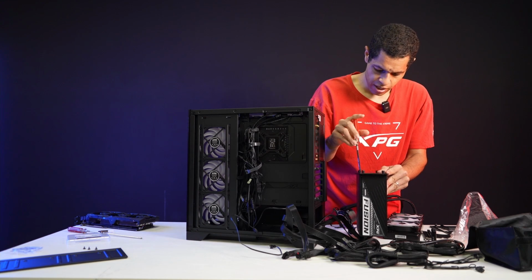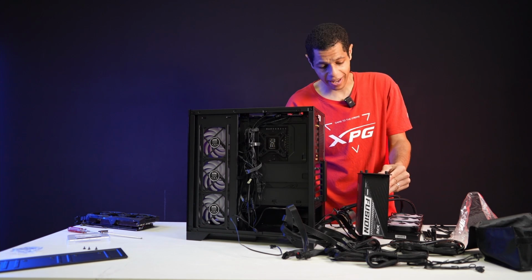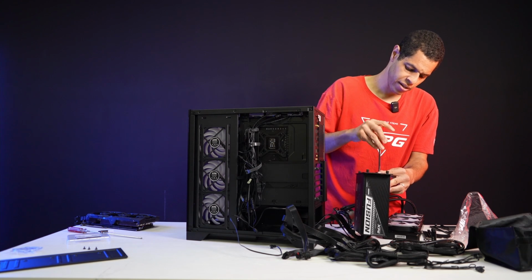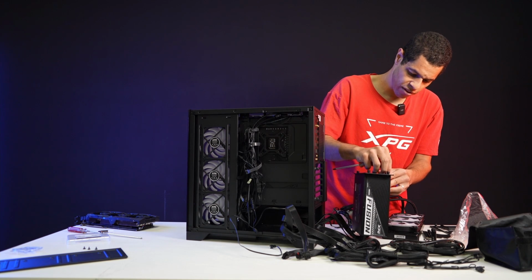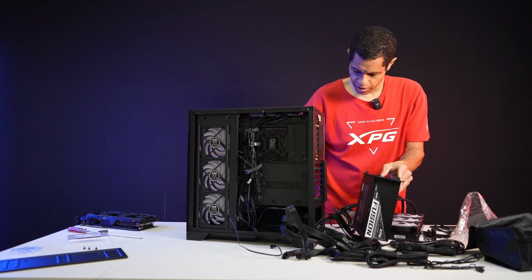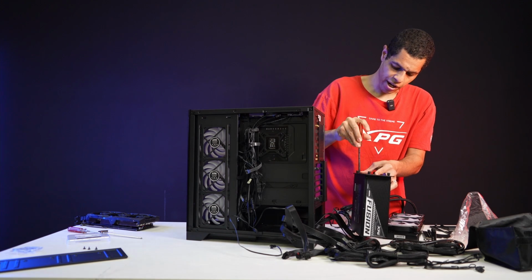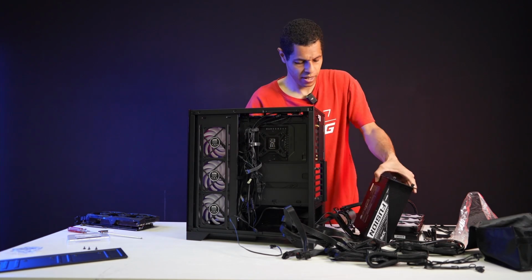All right. And yeah, these screws aren't toolless. They never are. And they shouldn't be. But putting the bracket back onto the case is toolless, so that part will be very easy to do. So again, we're going to do the diagonal. You do one, and then opposite diagonal side, and then another one opposite diagonal side. So let's do that. Get all these 4 on. Very nice, going pretty easily. And again, I should have done this before I started to try to put this PSU in, which is why now I'm sitting on these cables badly, but we'll be fine.